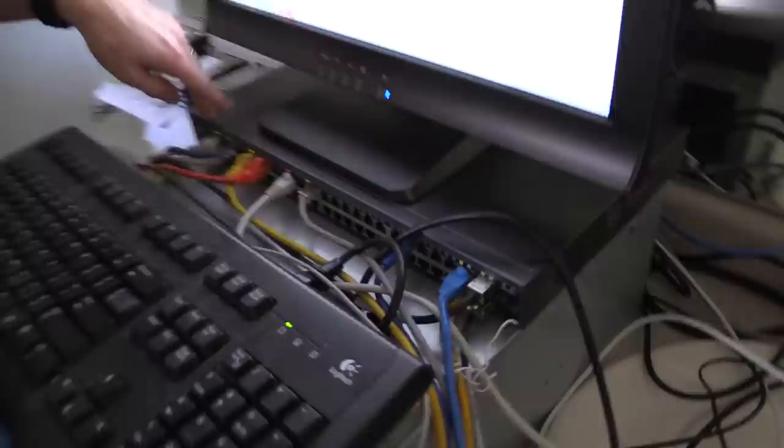This is mostly gigabit, but also 10 gigabit. So there's a 10 gigabit link to our server that also runs to Edsel's machine, since he's the one who, back when we set this up, was doing most of the very high bitrate content editing. This is our Netgear storage appliance that we use as an iSCSI drive so that Luke can install all of his games on a network drive whenever he's benchmarking, rather than install them locally and have to re-image those all the time.